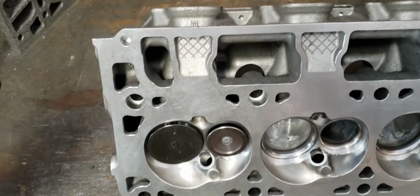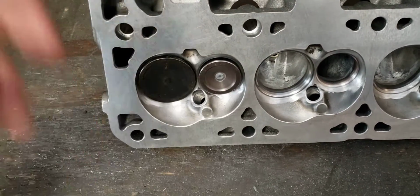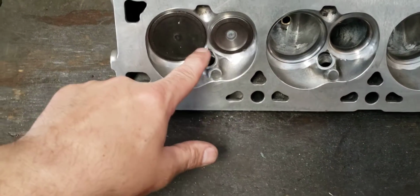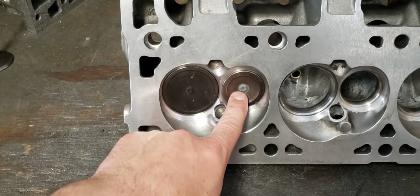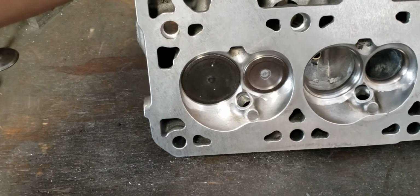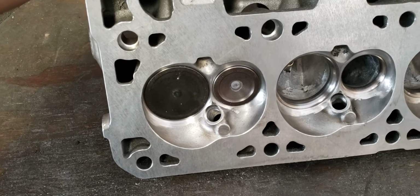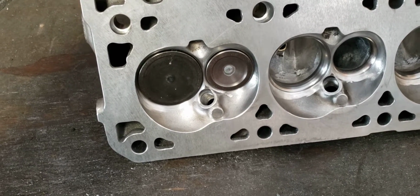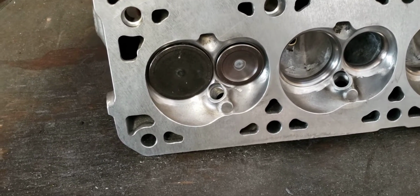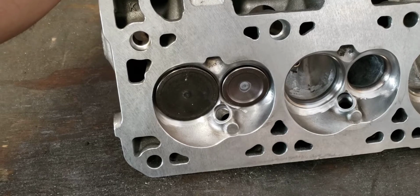If you remember in the last video, if you watched it, I talked about all the air being sucked in. It's not being forced in a naturally aspirated motor. So this becomes critically important: how well does the exhaust valve flow in your 100 to 300, 400 range? The reason I say that is because depending on the duration, your valve overlap, and where it happens, that will determine how far to being closed the exhaust valve is when your intake valve actually opens. So I try and focus on that 300 and lower area. Conventional wisdom says that there's a backflow problem and you want to limit low lift. I have not seen that happen or pan out on the track or the dyno ever.